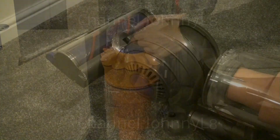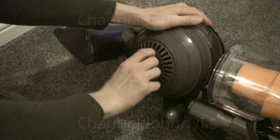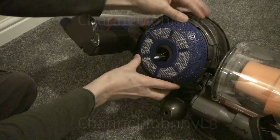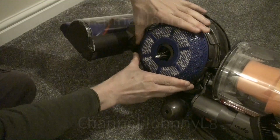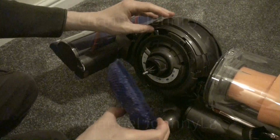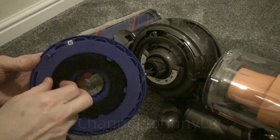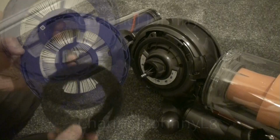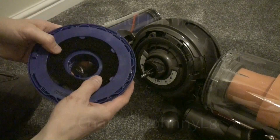The other one, the HEPA filter, is in the ball, so you just have to unscrew the clip and take the cover off and then you can twist it out. It's got a spongy bit on one side now, protected with a plastic grill. The HEPA folded paper bits inside, and there's now like a black sponge baffle in there which needs to be taken out and rinsed as well. You can sort of push the baffle back in under the 4 plastic clips to hold it. I think the sponge and the baffle are in there now to help suppress noise.